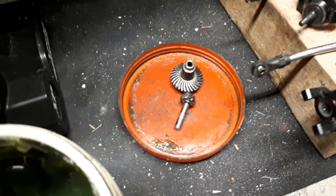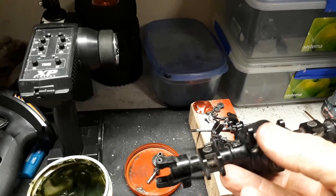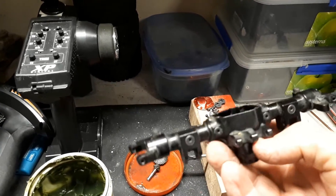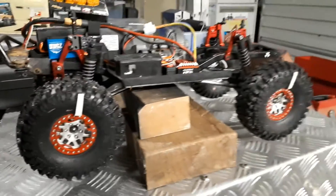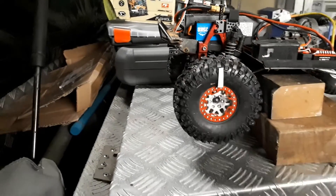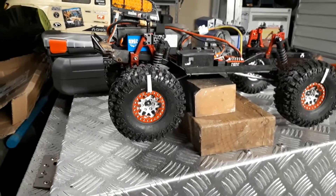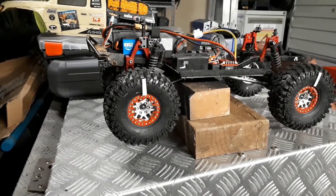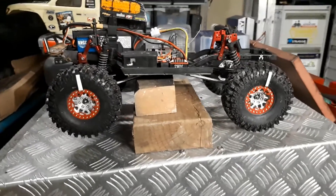So what I've done is I've swapped them over because the ones in these axles - the Amazon axles - I think it was 24 tooth, whereas that one's a 30 tooth. So I thought, well, that's going to give me overdrive because it's going to be a lot faster in the front on this one. So I've swapped them - they both fit, everything else is original in here. The axles use the same bearings. All I did was change the center and the crown and pinion gear. They're both exactly the same fit, all the bearings, everything. So I've put them in. I've set up some tape just to show you the difference, so hopefully this shows you.